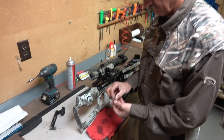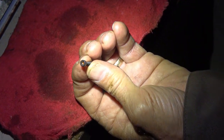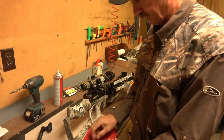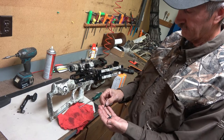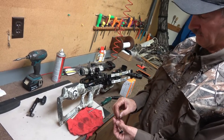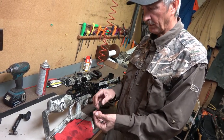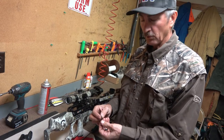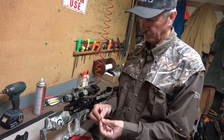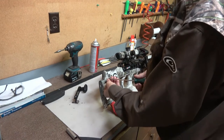You can still see a little bit of rust in this bolt head — that is the area where your Allen wrench has to go in to remove that screw. If that rust stays in there and the screw cannot be removed, the only option is to send it back to 10-point and let them deal with it. With the amount of money this crossbow costs — and it's very expensive — it puzzles me why they would not use stainless screws or a better corrosion-resistant coating on these screws, since they know it's going to be used in inclement weather and will get wet.